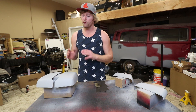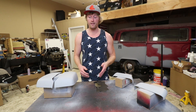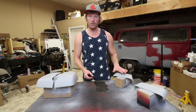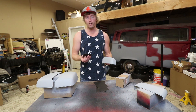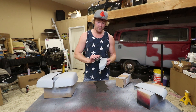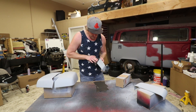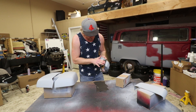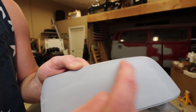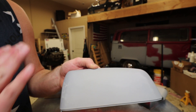So it's the next day — I let them sit overnight. Now when it's in primer, you don't have to let it sit overnight; it's good to let them sit for about an hour or so at least before you start sanding. It was pretty late last night so I just decided to call it and go home. So what you need to do once it's good and dry is take your 800 grit. You can use a block, but on the smaller pieces you don't really need to. Don't put a lot of pressure — same as when we were doing with the pad. Just let the paper do the work, because if you don't you're going to get finger marks in it. Just easily sand it. You can see where the first pass has dimples and this part right here is smooth — just make sure the whole thing is nice and smooth, no dimples at all, and you'll get a nice base coat.